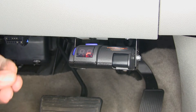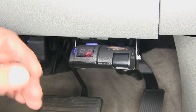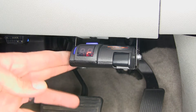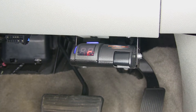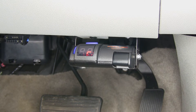This is going to give us an initial, immediate braking force to get everything started, and then it will revert back to the proportional aspect and only use what's required to get our trailer and vehicle safely stopped. With the proportional system rather than a time-delayed system, this is going to allow us to use just the braking force we need, and it won't cause the brakes to overheat when we're sitting at a stop.